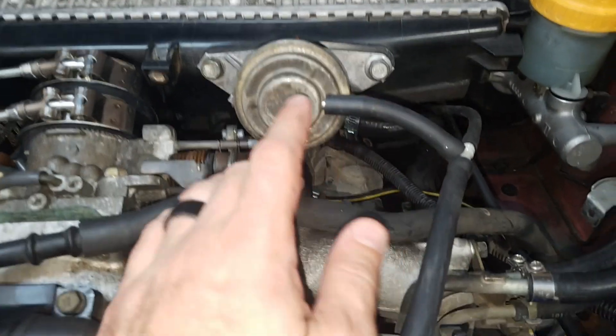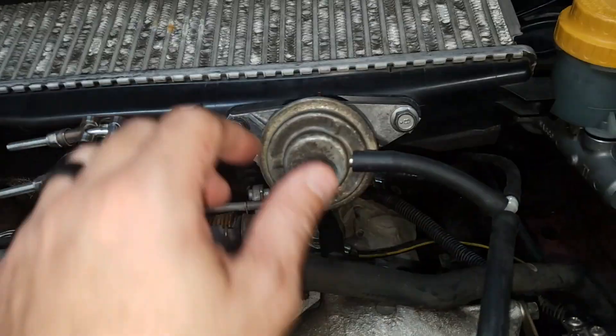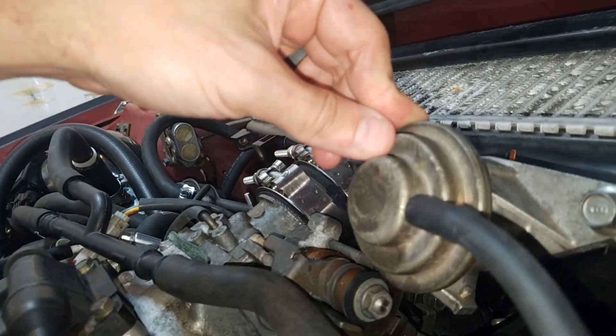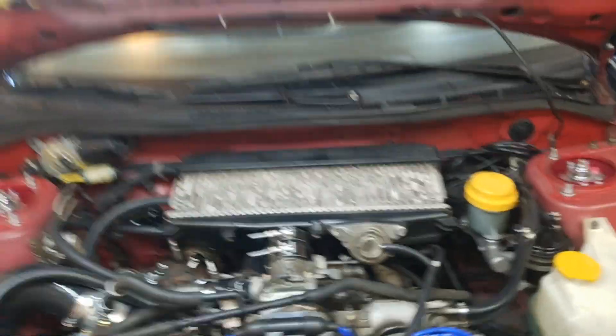What you need to do is crush the blow-off valve cap. You can do that in two ways: you can put it in a vise, which is probably the cleaner way — I did this on my previous car with a vise but I don't have one anymore. You can use a C-clamp as well. What I actually did was just take a ball peen and lightly tap right here in this area — just kind of round it out, tap here, here, here. Don't pound it in until there's nothing left. Give it about a quarter to half inch in. What that does is create more spring tension on the blow-off valve, so there's not as much play between that and the actual spring. I did that actually while the car was running because I knew it was the problem — first tap I gave it, very light, it already stopped surging. That was the issue.